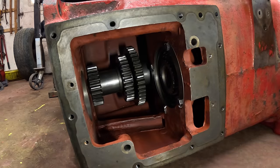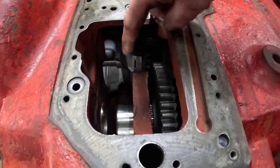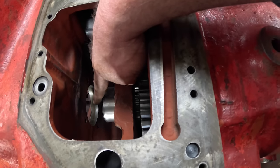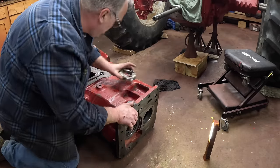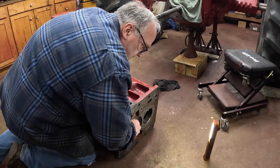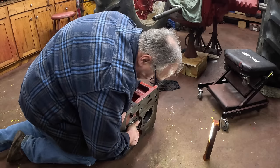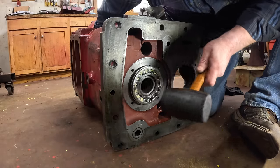Looking in the case, you can see the MCV and the torque amplifier, with the first constant mesh gear and the end of the counter shaft - it's got to come in pretty much flush, with the needle bearings in this baffle. Before I put the rear bearing on, I want to bring the shaft through the case enough to seat it on the counter shaft and in its bore at the same time. The counter shaft is seated, and hopefully that'll keep me from having to align it with the bearing as I'm pushing the shaft through. I should have put this retainer on before I started.